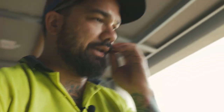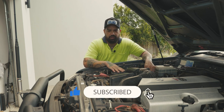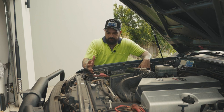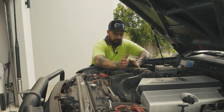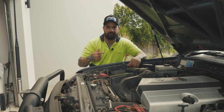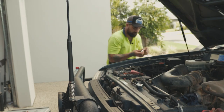It's got the big outlet here, so that's going to be perfect for the Armax snorkel. This is the old system - these are pretty good, I'm not going to knock them, it's Toyota, it's genuine. There are a lot of restrictors here and these things kind of help with that sucking noise you get from induction systems. Essentially we're going to be blanking all this stuff out - the airbox is going to fit straight in, just a single pipe all the way through to the throttle body. Then we're going to pull out the old snorkel and install the Armax one.